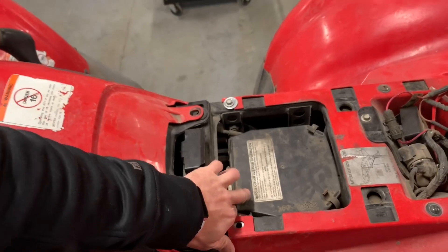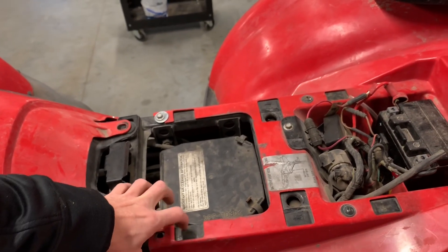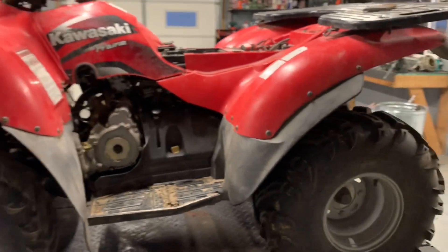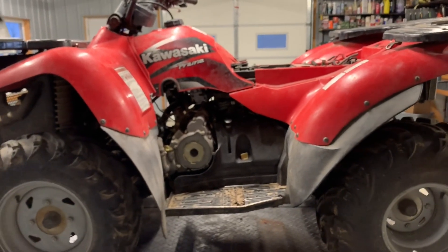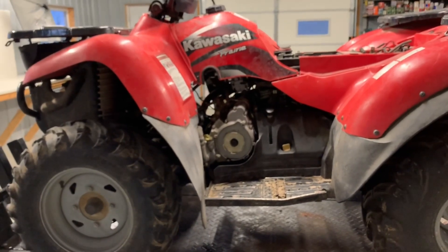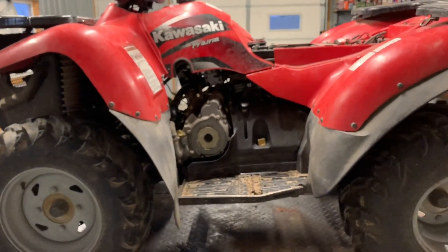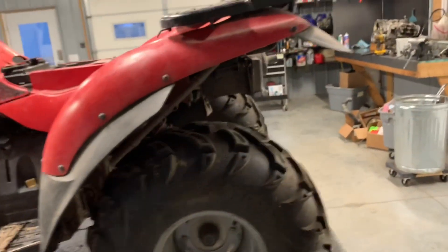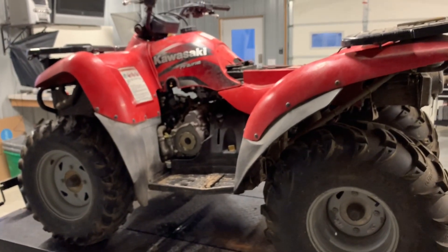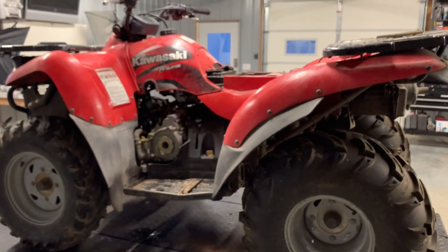The air box is here with four clips to open it up. Make sure you check the air filter at least every time you service your four-wheeler — it's very essential that filter is clean and in good condition. This was a complete overview of the Kawasaki Prairie 400 four-wheel drive, which is automatic. They also make this in two-wheel drive — the major difference is the front end: different A-arms, different shocks, different hubs, and no prop shaft going to the front. If you've got questions, leave them in the comments below. If this video was helpful, please subscribe, like, and share.